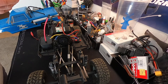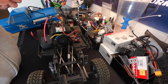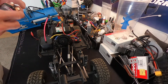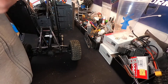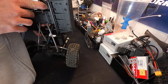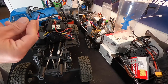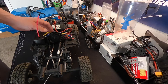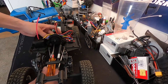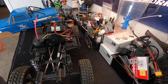Just like the picture showed. Basically all I did was move the screw from one side of the line to the other, about the same amount. Pretty easy. Now that's got backwards timing for the correct wiring, but correct timing for the wrong wiring — that makes a lot of sense. You can figure this out ahead of time by looking at which way your motor needs to rotate and figuring out if it's clockwise or counterclockwise, and that tells you if you need to make any adjustments. Most motors for general usage are going to have some mechanical timing that makes them run better one direction. Even a rock crawl motor may have a little bit, because a slight advanced timing helps performance quite a bit. It's a real simple adjustment to make everything work better. Well worth it.